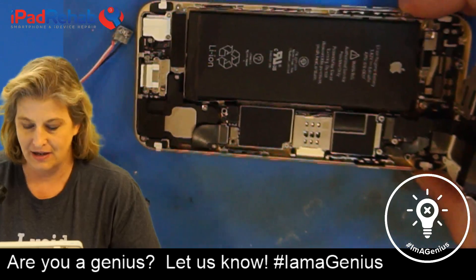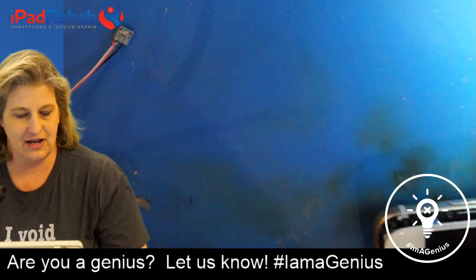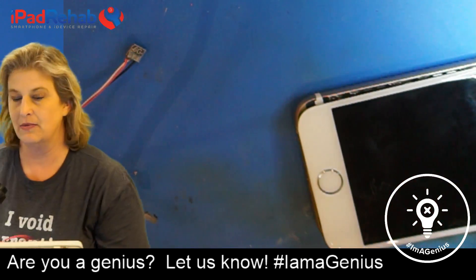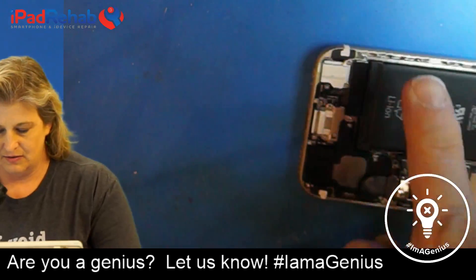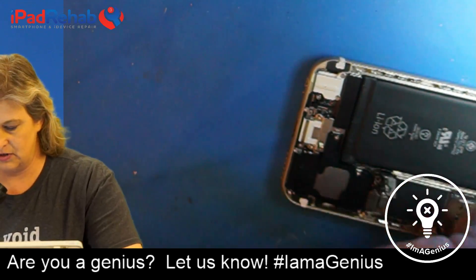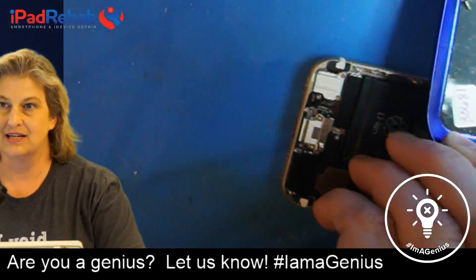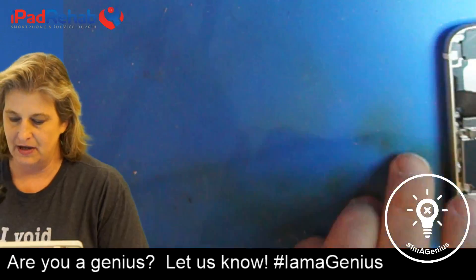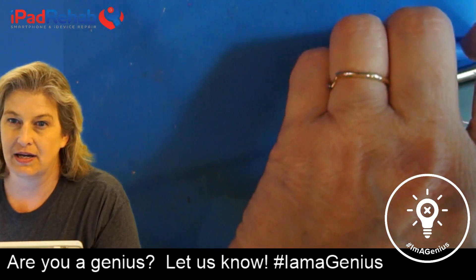It's likely a little capacitor — what I call Jess's Easter egg. This is really classic; any good micro solderer is going to instantly know to look at this spot on an iPhone 6. We'll use the multimeter to confirm that the main power rail is indeed shorted to ground. The only thing I've done to the phone so far is pop off the screen and remove the LCD shield.